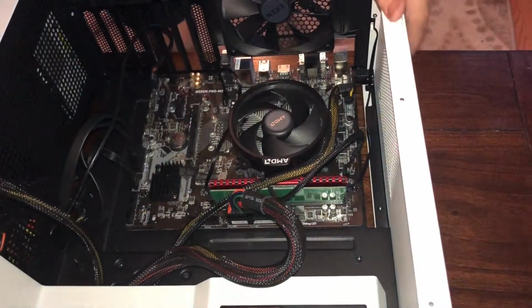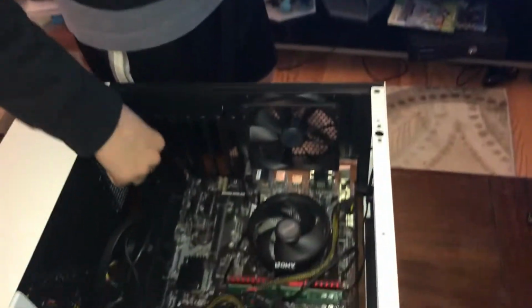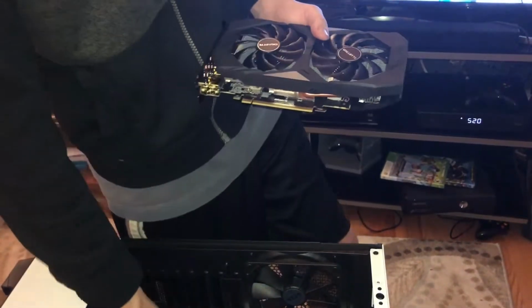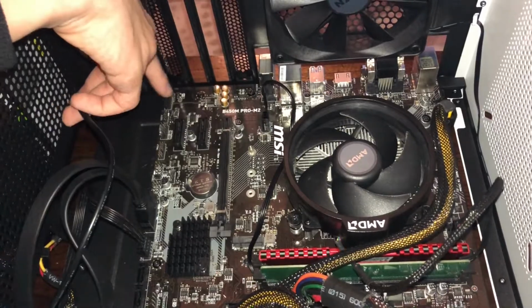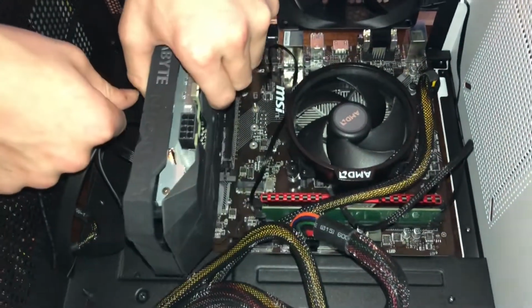And the last one is our PCIe connector, so that means we have to install our graphics card. Now this is a pretty simple task. You have a couple screws left, and you use them to hold your graphics card into place so it doesn't really move. This PCI X16 connector, you just kind of line it up with this, where it says PCIe_E1, and it's the longest one there most likely, and it's got a color.